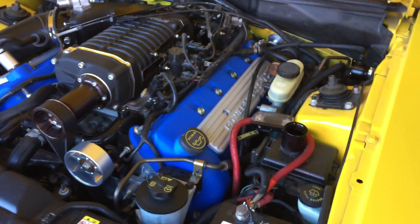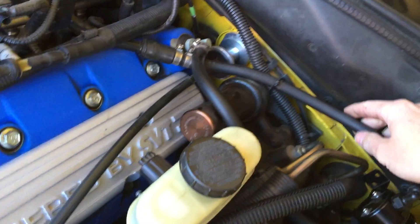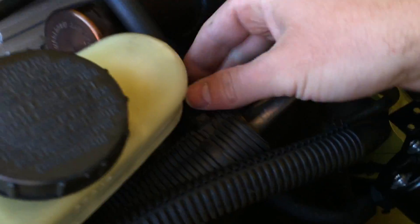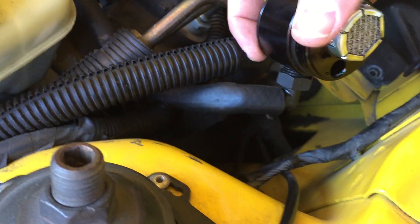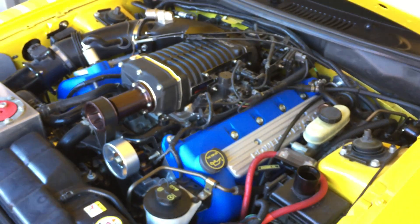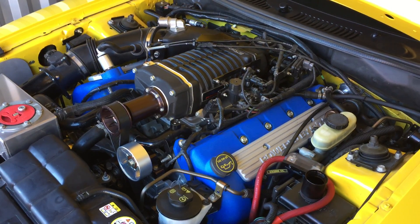A lot of people say if they just wipe it down after each run they're okay. Anyway, I just wanted to show this because even JLT's install video didn't really show it well from the bottom — they just showed hooking the hoses up. You want the line coming from the cam cover to drop directly into the can, and the side with the filter to be the one that goes back into the intake manifold. If you have any questions or comments go ahead and drop them in the comment section — thanks for watching.